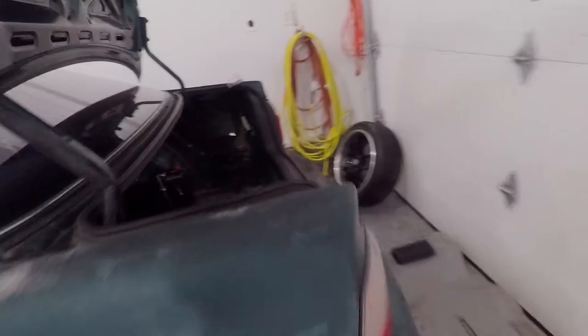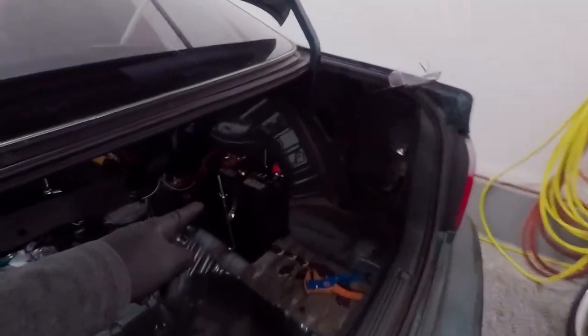I got some new ideas about the battery too. For the ground, I actually want to run it through a plug in the trunk and connect it to the frame underneath the trunk. I think that'll actually be a better ground than the strut tower up there that I was going to go for. And then I also won't have to worry about when I want to take the strut out, having the ground come off. I think it'll just be better to go underneath.